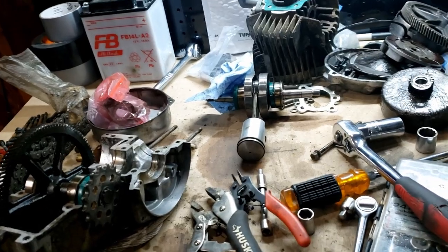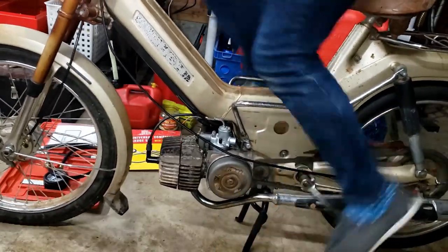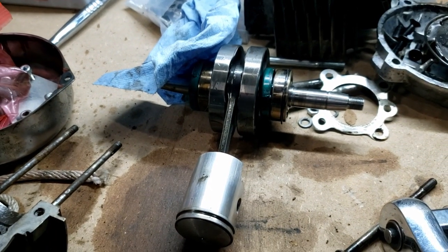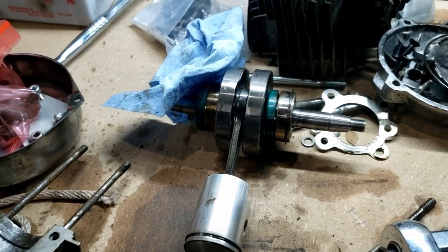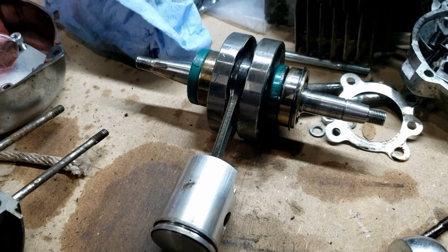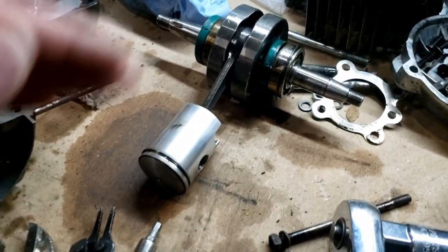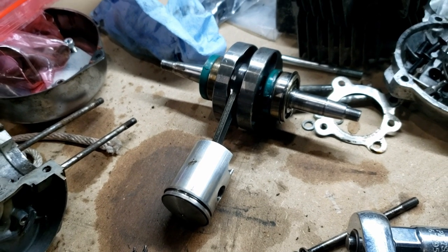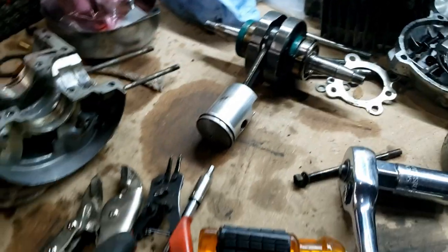It also was making this horrible ear-piercing sound — I'm sorry to folks who have headphones, bear with me here. So what could that be? My first thoughts were the seals sitting on the crankshaft — I didn't grease those seals. I like to grease seals when I put them on: you grease the inside of the seal lip and it slides on real nice. I didn't do that on the crankshaft this time, and I think that might have been my downfall. I've built other E50s and that's never been an issue before, but I fear that might be an issue here. So we're going to pop these seals off, see what they look like, and then reassemble. If that seal is somehow getting twisted and pushed around, that would cause a major air leak and could cause a no-start symptom. I could barely get it to start at full choke and pedaling my brains out, but it's still very unsatisfying.